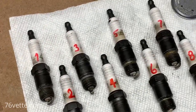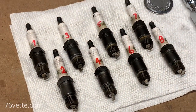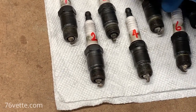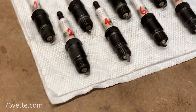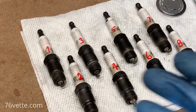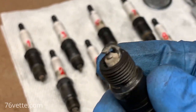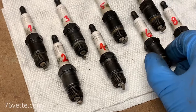All the spark plugs are out. I like to mark them so I know what I'm looking at. Number five — I'm going to blame that on the poor gap adjustment, which as I showed you was off by quite a bit. It doesn't sound like a lot, but it makes a huge difference apparently. Also that boot may be causing some issues. There was another one that was not as bad, but the gap was off by a little bit too. So five and six are a little questionable.